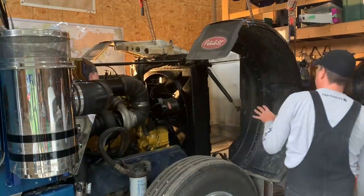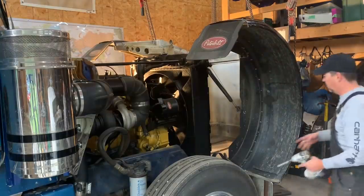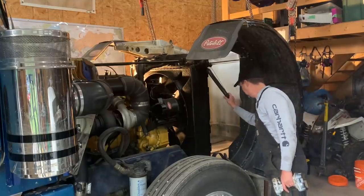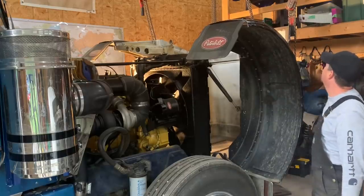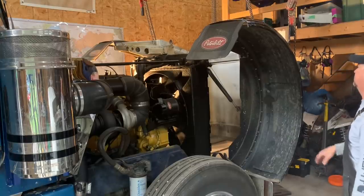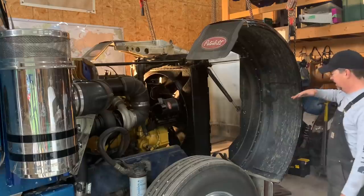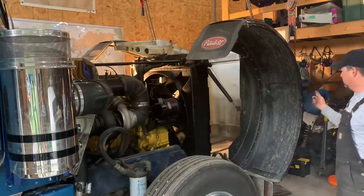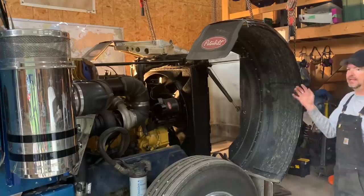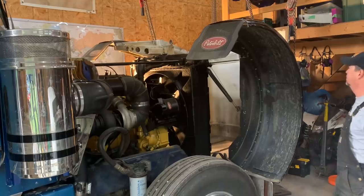What I need to do now is take off all the good stuff off of this hood. I'm going to take the mud flaps off, take the headlights, but leave the wiring of course because we'll just put this loom on the new hood. Disconnect the springs and then I'll put all four hooks on. I added a fourth chain fall - I tried to lift it with three and that's why it got all crooked. With four I put them on each corner and that way I can control it a little better when I put the new one on and line it up perfectly. I'll release the brackets and pull it up, back the truck out, set it on the trailer, and then do the reverse and put the white hood on.